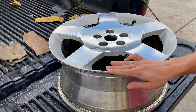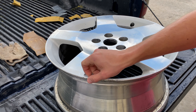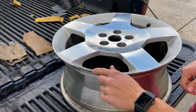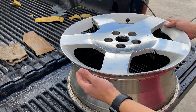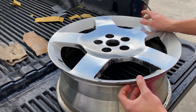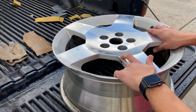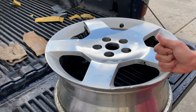Now what we're going to want to do is get some 80 grit sandpaper and sand down to bare metal where any super deep scratches are. Like this right here - this is the bent rim. We're just going to sand this down. I have a wire wheel attachment for the drill to get the inside all cleaned out. These little ones might be able to just sand down smooth, and we'll probably have to fill these right here. Once we're done sanding, we'll wipe it down with alcohol and get the Bondo out to fill it in. Let's get started.